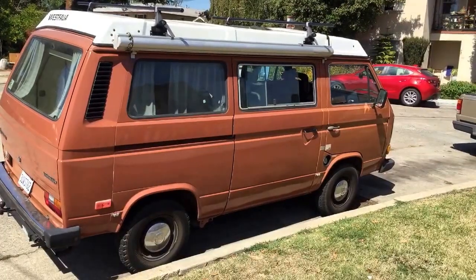You can see the rebuilt airflow meter is in there. The vibration is still there, so maybe I'm hoping that vibration is actually normal and it's the contacts instead — because they're newer — that are sending the right signal, or that the voltage change isn't as drastic when those contacts are better. I'm going to take it out for a test spin and see if this actually helped. Just driving around for a couple blocks so far so good. It had been stalling at idle and it's not doing that anymore. I'm about to take it on the freeway.